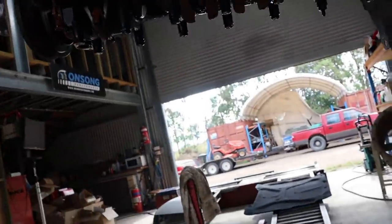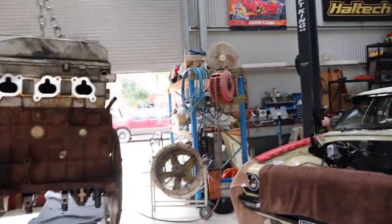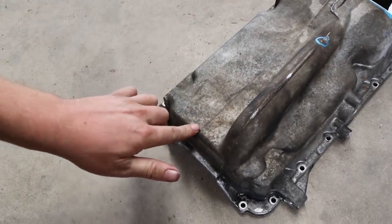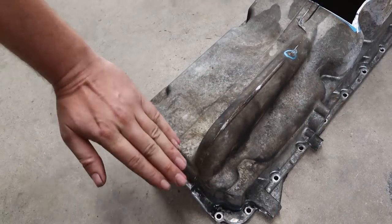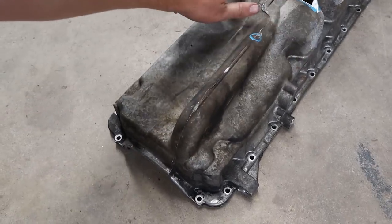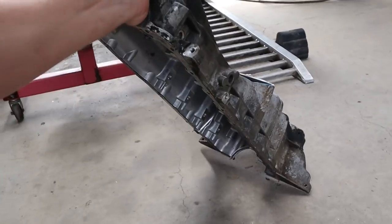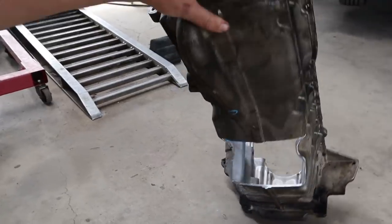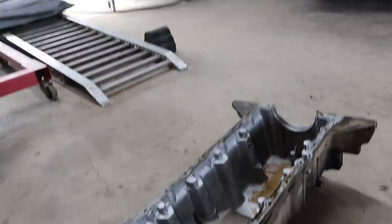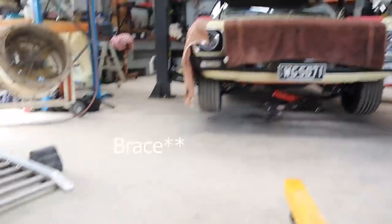We've done some measuring up and doing this should get us about 30 mil. Should be enough to get this thing to close and have some clearance. Basically from this edge here across to here would just be flat, eliminating the whole hump for the pickup — flat all the way back to where we've made this cut here. That distance picks us up about 30 mil where it's hitting the drag link. We could still drop it another 20 from where it was sitting, giving us 20 mil further down on top, plus if we take the skin out of the bonnet we'd probably have some clearance and actually have this work.